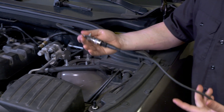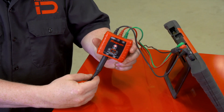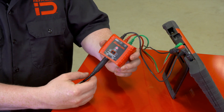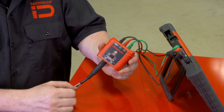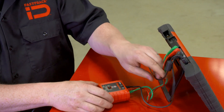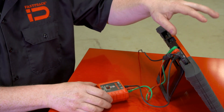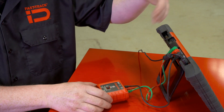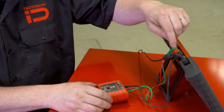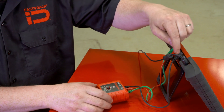It has the included connector cable, which connects to a pressure transducer adapter. It's a two-channel adapter, able to use two separate pressure transducers if you wanted to measure two separate pressures. At the other end, they connect into the standard connectors on top of the tool. Note that connector one on the tool is yellow, but on the adapter it is red, as it's made to work on multiple tools. Red will go into the yellow, green will go into the green, and black goes into black.